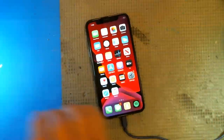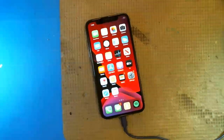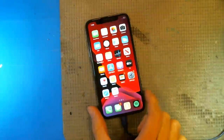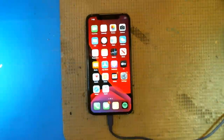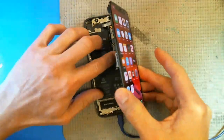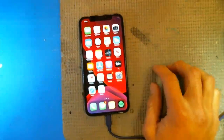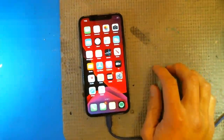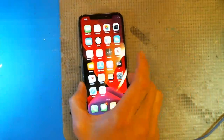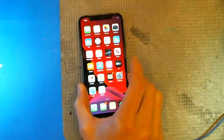I'm going to tell you what I've discovered through some searching on Facebook groups and some testing on my own. This is an iPhone X right here that's going to boot loop in probably a minute or so. The first thing I found after searching one of the micro-soldering Facebook groups is that the charge board actually has to be plugged in in order for this thing to not boot loop.